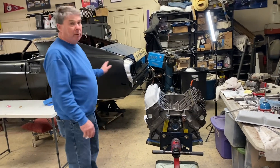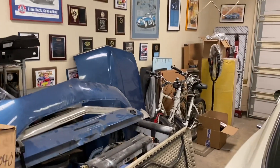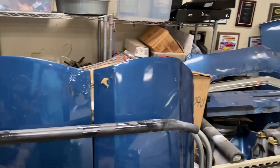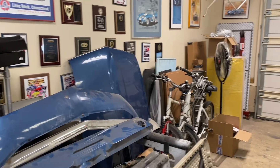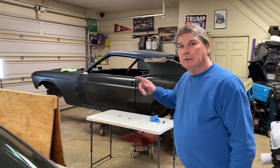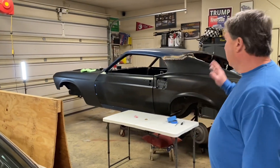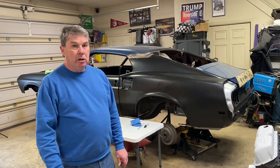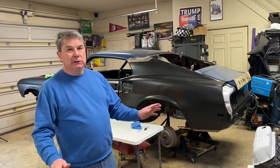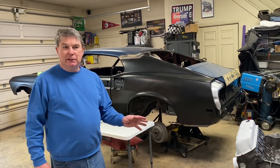Then I'll take this beautiful engine, wrap it in a plastic bag, and stick it in the corner. At that point we start getting the body ready for paint, getting everything buttoned up there — the hood, which is over against the wall, and the lower valence. I'm not using the front valence and the rear valence, but the hood I am using — it'll go along with the top of the car and the deck lid. I'll use the fender caps, end caps, quarter caps, and front fender caps. I'll strip all the paint off the hood, off the roof, off the deck lid, and have it primed in urethane primer and ready to go to paint. Then I'll have about six months where I have nothing to do except the dash, the heater, the wiring, and everything else.